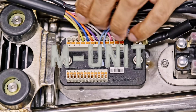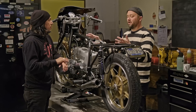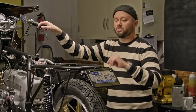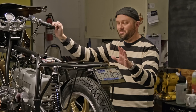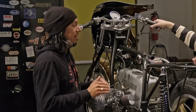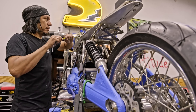Let me ask you about the M unit — do you still like it? I do, I like it a lot, I think it's definitely worthwhile. But that depends, right? Something like this bike is getting all the bells and whistles — lights, turn signals, horn, we're refinishing the frame. But if you just wanted to put bar-end turn signals on, you don't necessarily need a new wiring harness if your bike is already reliable and your charging system works. You might just want to wire in a new bar and turn signal — you don't need an M unit for that. People don't realize we sell M units only for people who really need to reassess and redesign the entire system. If you're building something super minimal like a chopper or cafe racer with just a headlight and tail light, you don't really need the M unit.